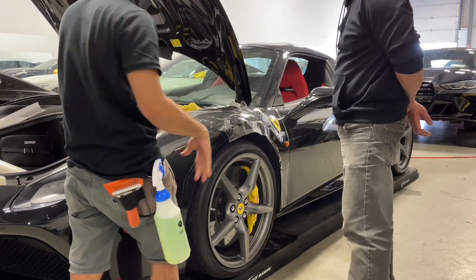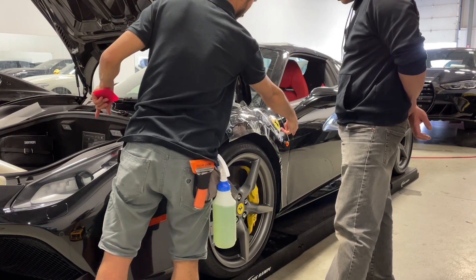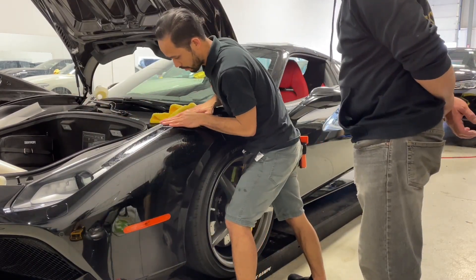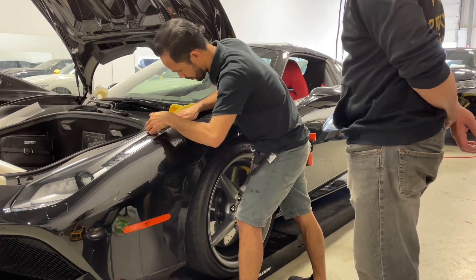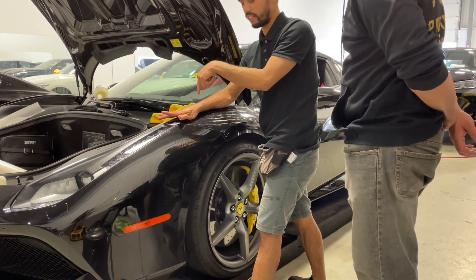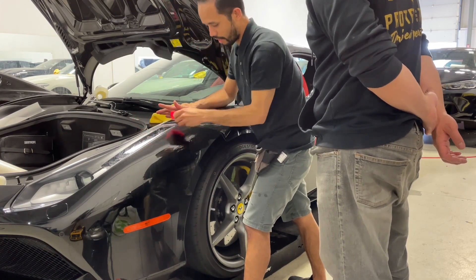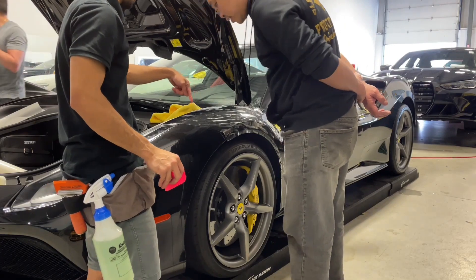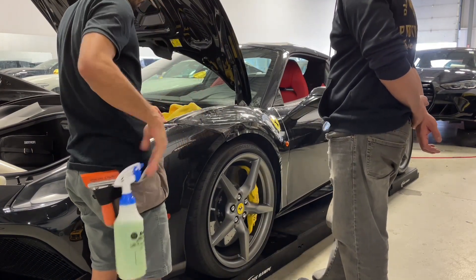Let's proceed to the front end, the front corner. I put my palm in there and stretch a little bit — a little bit above the corner and a little bit over the joints or the cracks. As you can see right here, I'm leaving my finger right there, leaving a mark — it's gonna be a fingerprint. So what I'm gonna do is lock that corner down, make sure it won't move. After that, lift it up — see those marks, those fingerprints? I spray that down and line up again, squeegeeing along the line, making sure there's an even gap at the bottom and top.